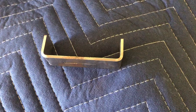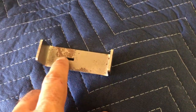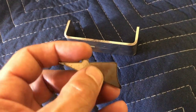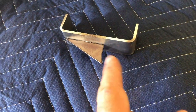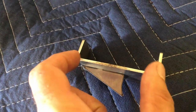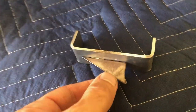One nice thing I noticed about these brackets from Motion Raceworks that go on the bottom of that lower radiator core support: this is where the radiator rubber will sit in, and the lower part has a little slot in it. They provided this little bracket that goes with it — it's got a little nipple on the top that slides right into the slot, and then you can move it back and forth. That will brace it so you've got a surface to weld down and across to strengthen this piece, and they went the extra mile putting that little slot in so you can slide it back and forth to position it — I thought that was kind of neat. I got the lower radiator perches mounted and welded onto the bar.